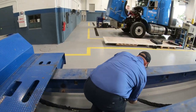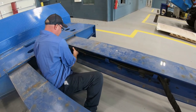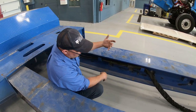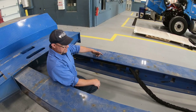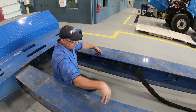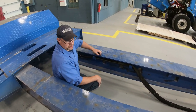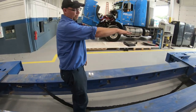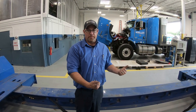The key feature here is we have these little metal hooks so the hoses will sit in these hooks — they're meant for the hose. You probably want to run a bungee strap or some type of tie wrap up here, because going down the road there's a possibility it vibrates out. The reason we did that was we didn't want several airlines in the rails like the previous trailers, so we did one umbilical cord. To close the trailer you just do the opposite — take the cord back out, put it back away, pull the safety pins, close the big pins, and back up.